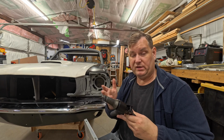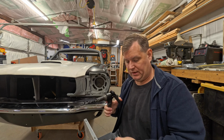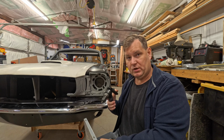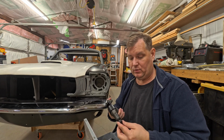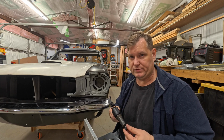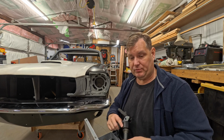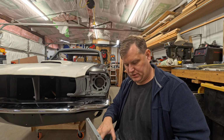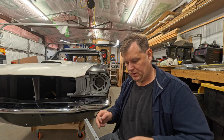It could be just that it needs a little more oil in it. So that could just be me. The only thing I will say that you want to stay away from on these, other than I'm dropping parts, I mean, this is a great tool because this will do your riv nuts, and it will do rivets up to, you know, heavy duty. No, I'm not talking the cheap rivets, the aluminum things you buy at the hardware store. I'm talking real rivets, real pop rivets. So it'll put real pop rivets in. The only problem you have with this tool is that it is SAE only in most cases, and especially when you buy this way.